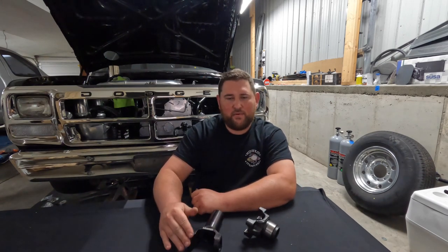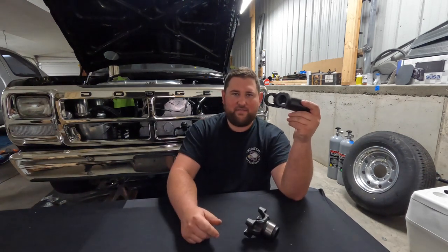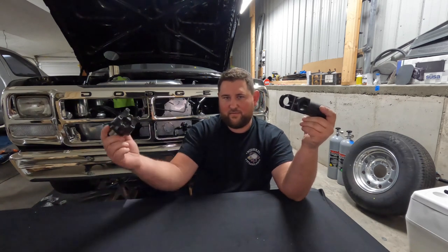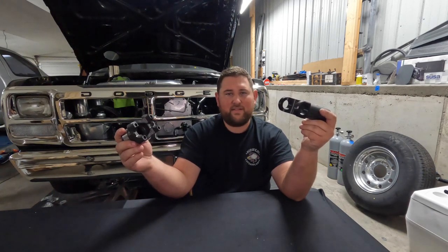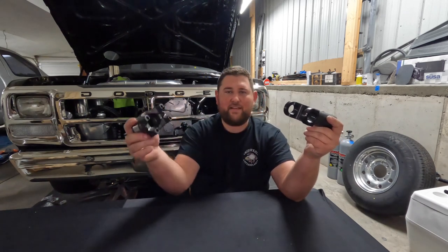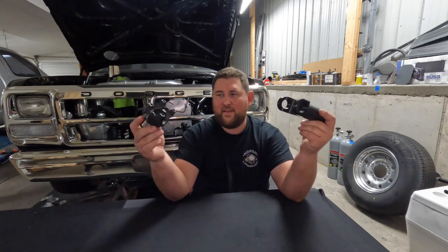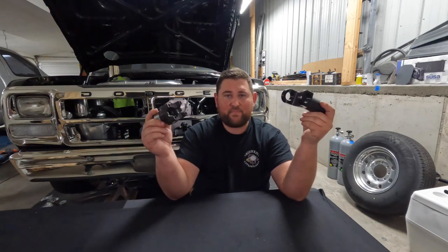The other problem with four-wheel drive racing — referencing back to the last driveshaft video — is that if you have your setup from the crank to the pinion on a perfectly straight plane, say at a five-degree angle, well, you are married to a five-degree angle on the yoke on your transfer case side. But the front axle could be independent of that. It's not necessarily going to be on the same plane as the rear driveline. So you might have five degrees of downward angle on the yoke out of the front of the transfer case, but your front axle might be positive three degrees the other way. And so it might end up looking like that picture — and as we saw, that's a no-no.